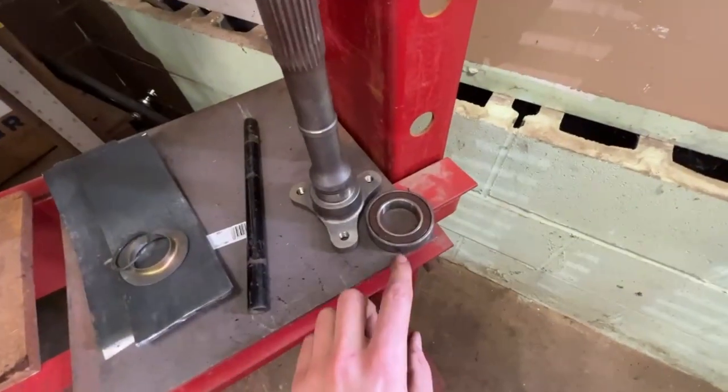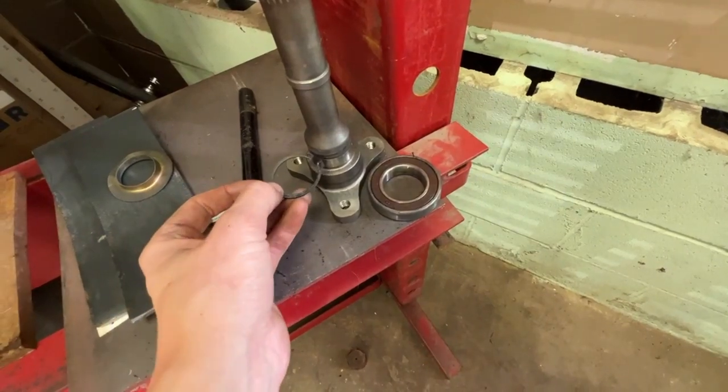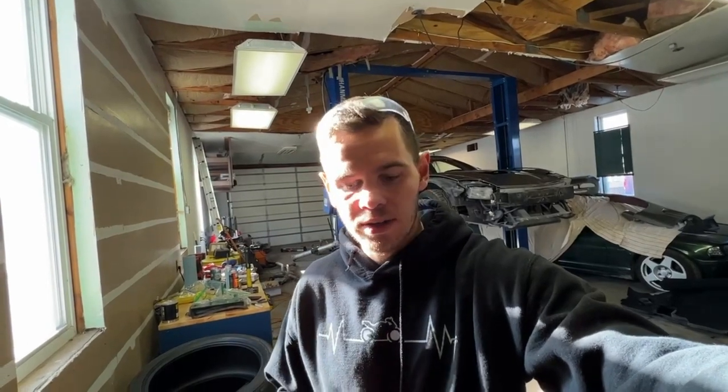I kind of struggled at the press because this bearing was here and this dust cover was over it, and I didn't know there was a retaining clip before the bearing. So I was trying to press the bearing out with the retaining clip still in and obviously that didn't go so well. I looked back at it again, noticed the clip, took the clip off, and the bearing pressed right out. All good there. Gonna push on the new bearing, put the new retaining clip on, and put the new dust seal on. For anyone doing that — there's a retaining clip there. Make sure you take it off before you try to press the bearing out, because I almost killed myself.